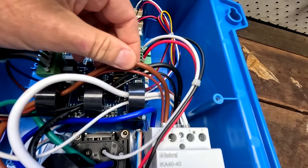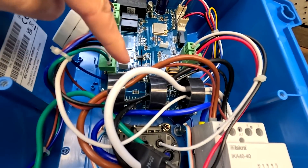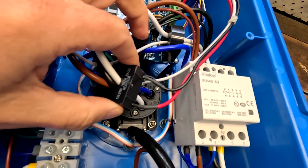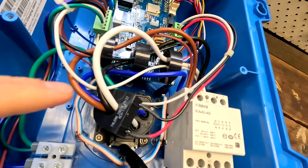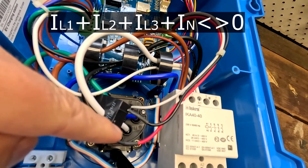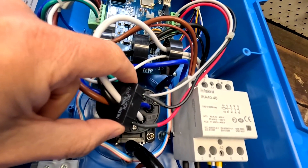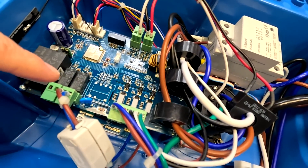We've got the power input at the bottom of the contactor with what looks like 6mm cable. Each of the active phases goes through a current transformer on the main PCB, and then all three active phases including the neutral go through another current transformer. I believe this second CT is purely for safety — if there's a ground fault, the sum of current going in and out of your vehicle won't match, the electronics will detect this and disconnect the contactor, acting like an RCD function.